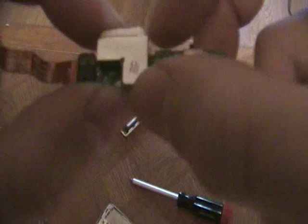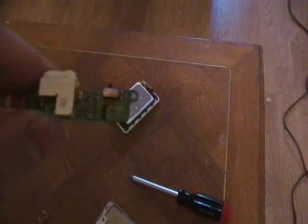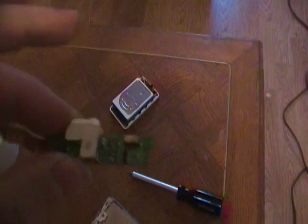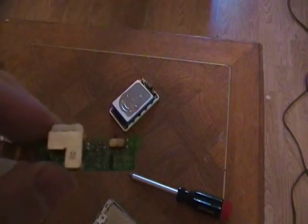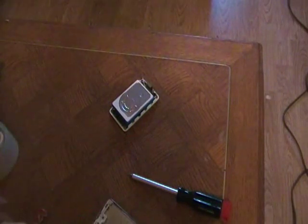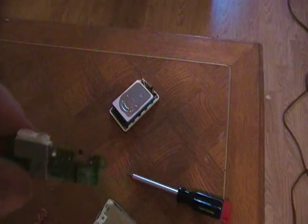You don't even need the ribbon cable — the ribbon cable can come out just by lifting this clip up. So you just need this piece right here, and it already has the earphone jack. You might be able to find these online — people are selling parts. If you can't find it, I recommend buying the whole iPod. They sell them broken online too. There's a good chance that this might work — these things don't go bad that often, they're pretty durable. Just get the whole iPod, take this out, and use it to fix yours. There are some other parts you could probably use from the one you buy as well. So that's my best advice.